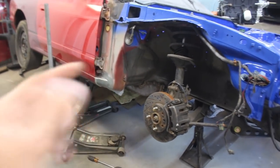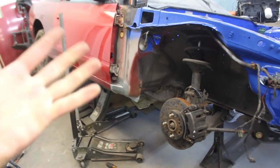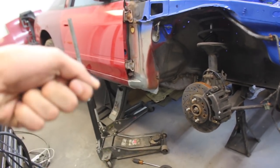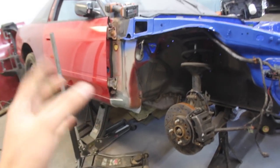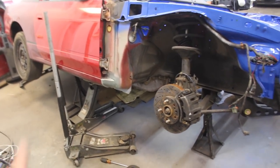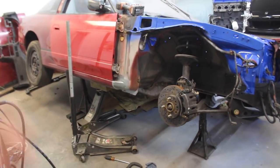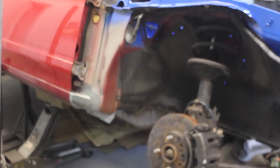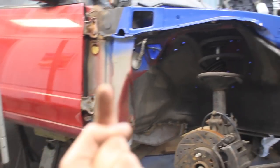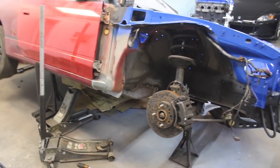With the torch, since I'm welding the seam, I'm putting the torch upwards, not downwards into the crack. That's basically why gravity is not on my side. I need to figure out a way to get the torch and the wire to feed into that gap, as opposed to above or below it - that's why I'm not getting that quality job. I'm no fabricator, I'm learning, but this will be fine. I'm gonna do some grinding, clean it up, then weld the inside part, and we'll go ahead and clean it up, paint it up, and get it looking factory.